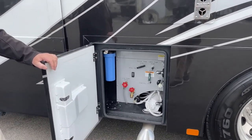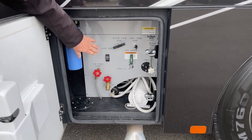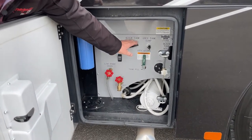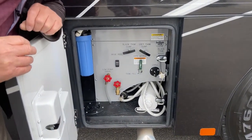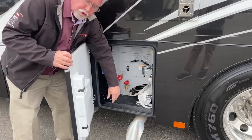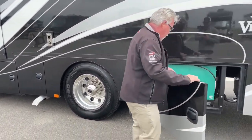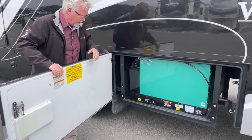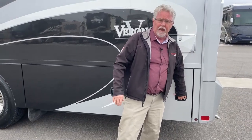This is our water compartment. Renegade does a great job here — you've got your power hose reel on both your water hose and your electrical hose, which are really nice. Whole-house filter here. Your black and gray dump valves are right here, and then this will be your black tank washout. After you dump your tank, you might want to rinse it out to help keep the odors down. Everything's easy to access, very neat and clean. You even have a place here to store your sewer hose. Here's your Onan 8,000-watt quiet generator — this generator has 351 hours on it. 8,000 watts is enough to run both air conditioners and all the electronics in the coach.